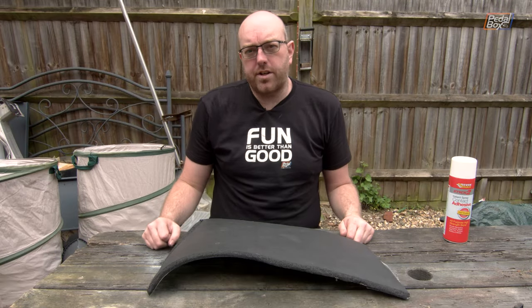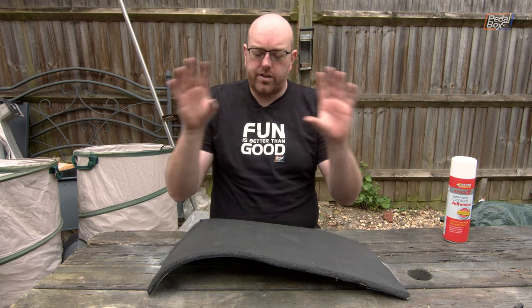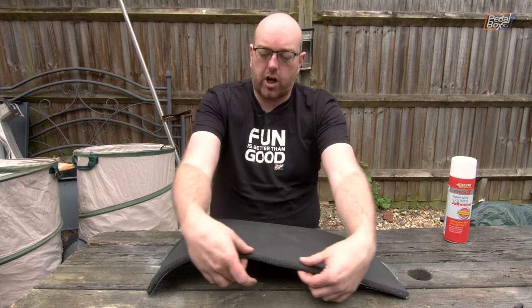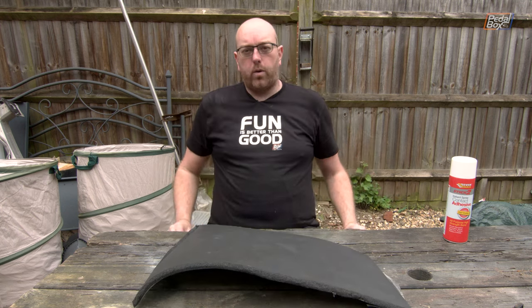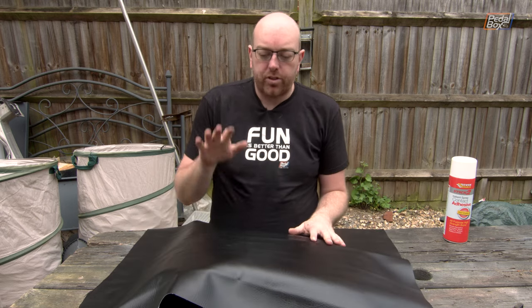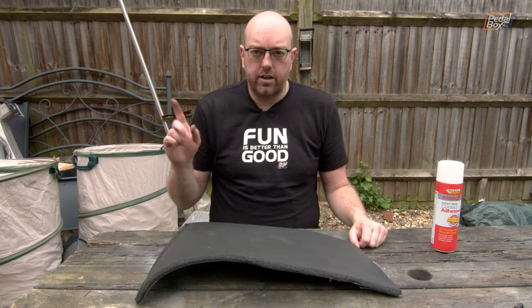While we've got some things printing, we're going to work on some cosmetic stuff. You might be asking why we're working on cosmetics when the car is on jack stands with no wheels and suspension to rebuild - but while working on the interior and getting the dimensions for printed parts right, we need to work out what to do with the dashboard pieces because they all need to be safe: padded and not sharp. There was a sharp edge around the very edge here which we've trimmed back about an eighth of an inch, so this foam will wrap around over the top when we put on our cloth. This leatherette is actually a dining room table cover - quite thick, hard-wearing with a little stretch - and it'll go down with contact adhesive.